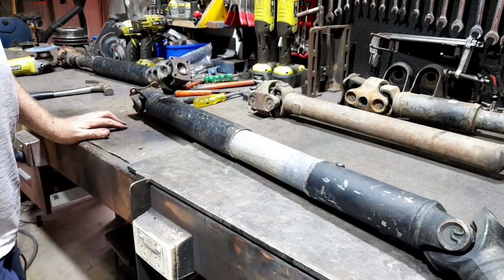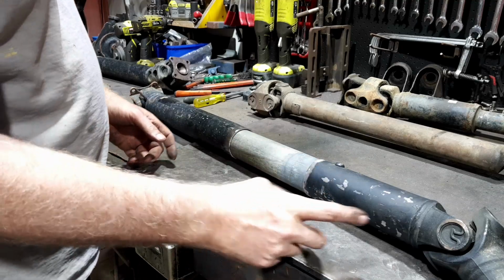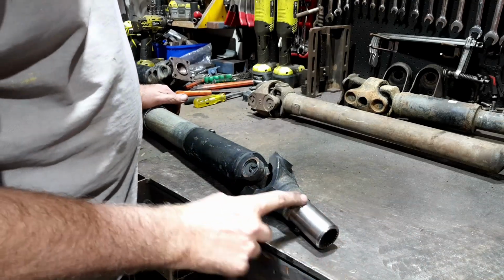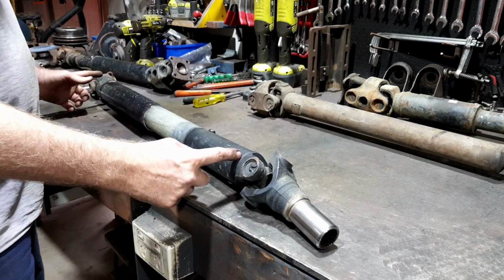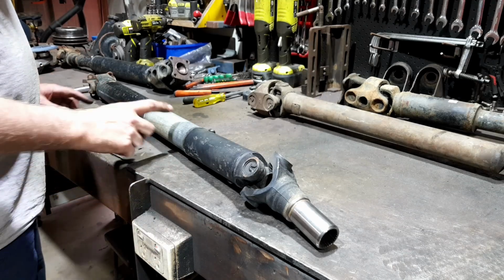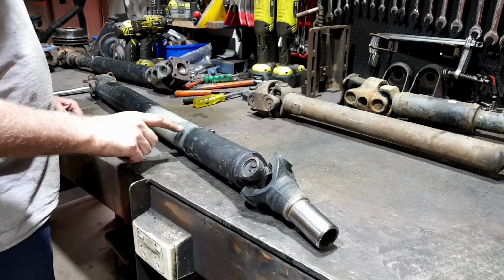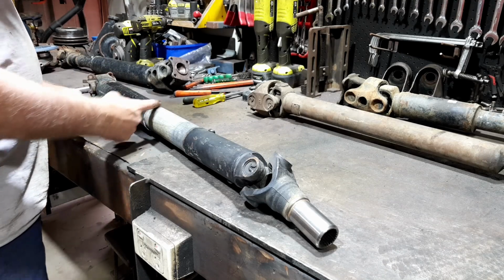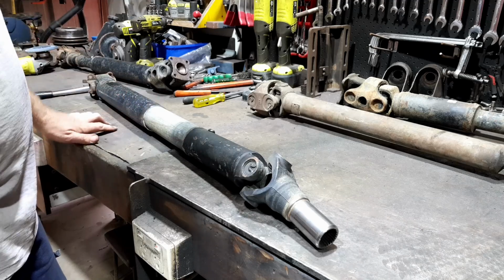So what I will do, so I know exactly how much of this to use and how far to drive this in, we'll get under the car, we'll slip this into the transmission, and we'll bolt this bit up to the diff, and then we'll work out the length. I'll take an actual measurement from there to there, and then I can try and clean the gal off this half so it slips in this a lot easier, and then I can actually weld it up, and then I can clean the gal off where the galvanized material is over the top of that one and make it fit.